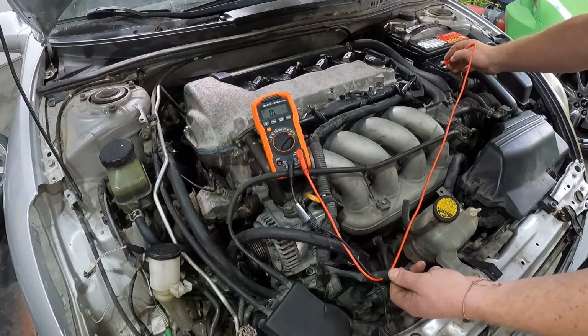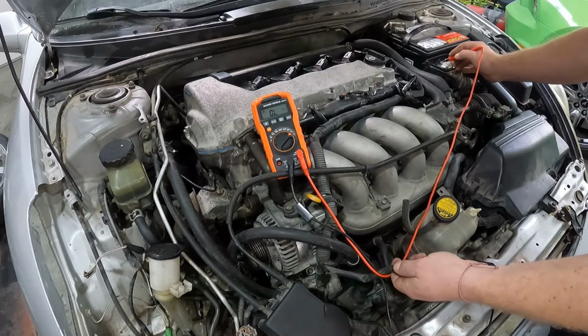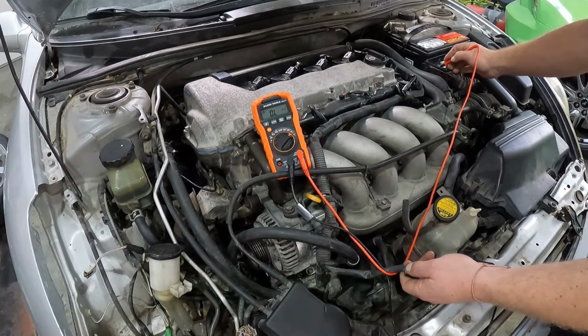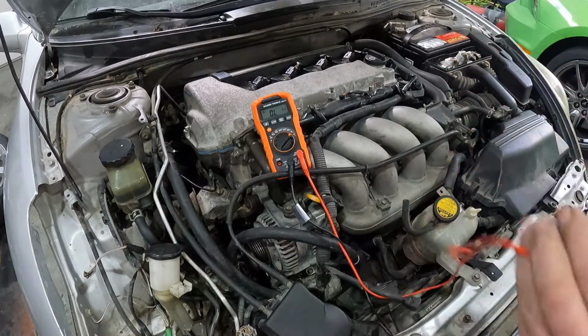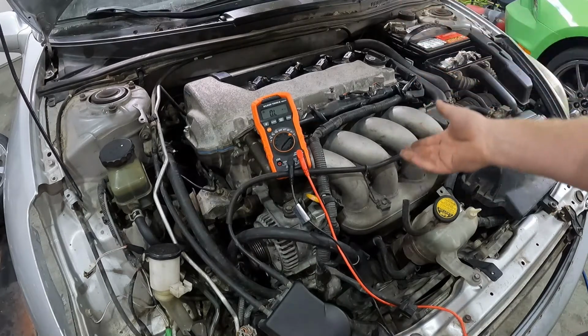These exposed cables over here on the blue connector, nothing. Switch wires, go to the brown and check, and nothing, which is good. That means the wires are okay between here and the ECU, 100%. So that you can check off. Okay, I don't have any broken wires. The sensor is good here. Well, what about the crank sensor?